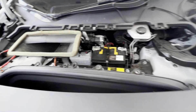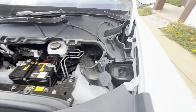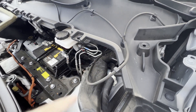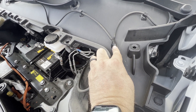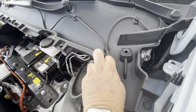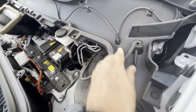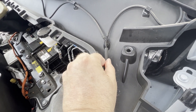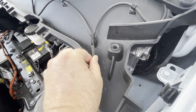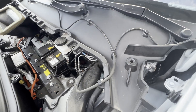Now you can see a whole bunch of stuff in there: there's the air intake, there's the 12 volt battery, and right here is where the problem was. The fluid was coming up to here, but this was actually unplugged — it wasn't plugged in. The fluid was squirting off all in here. So all I had to do was plug it in, and voila, we had windshield wiper fluid again.